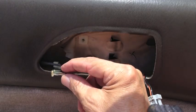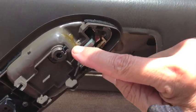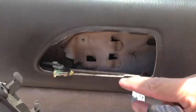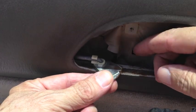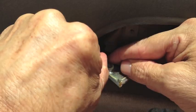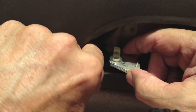And the same thing has happened again. That little piece fits in right here. You can see the old epoxy down there and some epoxy up here. To get this piece off of the rod that goes back to the locking mechanism, all you have to do is push that clip off of the rod — you can do that with your finger just like that. Then the rod will lift up straight out of it.